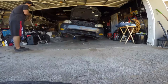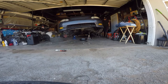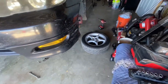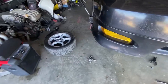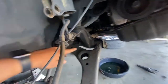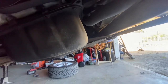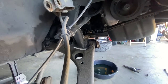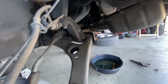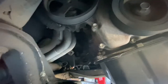Ari lifted it up, took the tire off on this side, and we're gonna start working on the subframe. We are gonna take the sway bar off — loosen up this bolt, that bolt — loosen up that motor mount or torque mount up there, and that's about it. There should be more bolts down there and this thing should drop down a little bit.